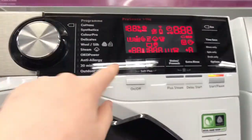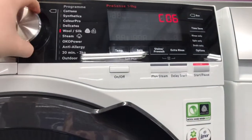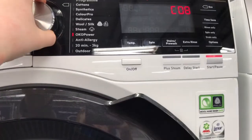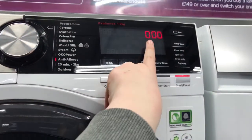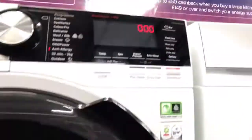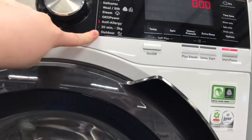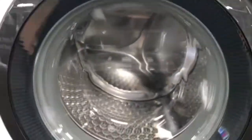You'll be presented with this — this is the user interface test. CO2 and all of these are water-controlled things. CO9 is a spin test, so it tells you the RPM. C11 is the last error code, and C10 is a Wi-Fi test and all sorts like that.